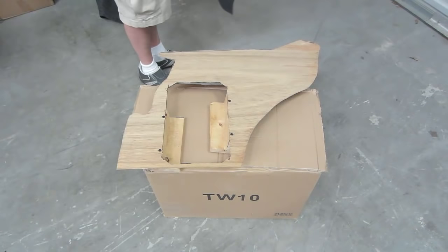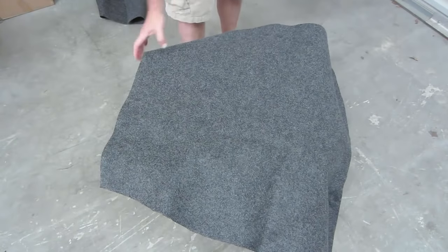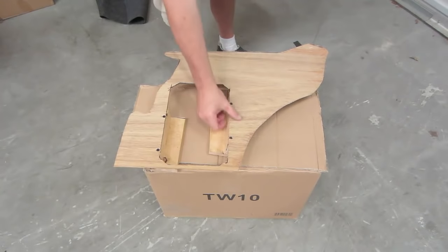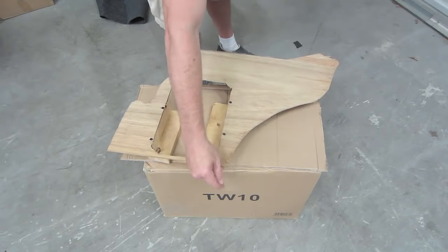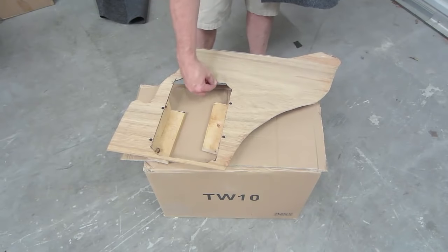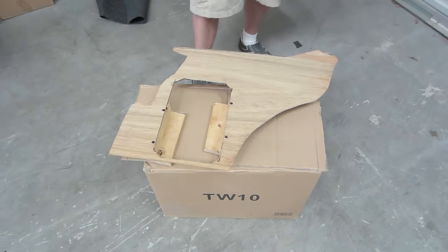Now we're at the final part of making this look great, and you're going to need a couple things: one, this spray glue, and of course some trunk liner material which we have here by the yard. I just cut out a piece which is going to be enough to cover it and wrap it around. First things first, let's make sure you get rid of any of these little straggly pieces of wood that might make it look a little funny, make lumps and stuff — you don't want that. This stuff takes really well to a knife, so if you have a little edge you want to finesse, a straight edge knife will work wonders on this stuff.